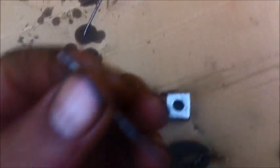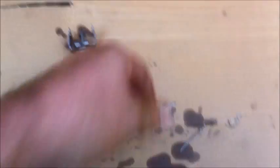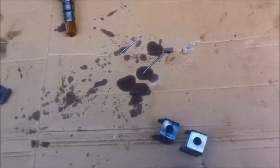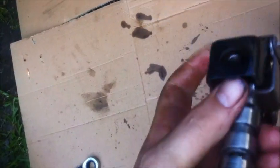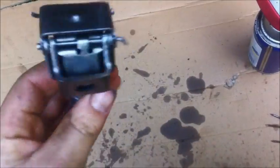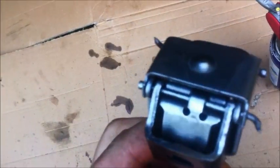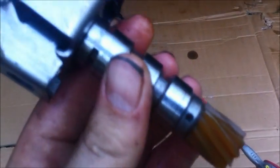I'm going to throw it back together. I also use 6d nails, which you can get from a hardware store, for pins, because you have to grind the stock ones out. Here it is finished with all the material cut off, as you can see. Everything should move freely when you're done. Pins back in, and hopefully we'll have at least a few hundred RPM higher shift points.